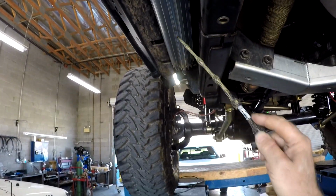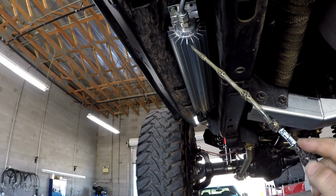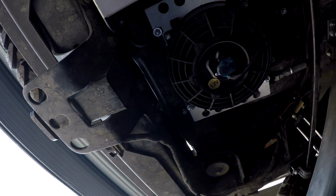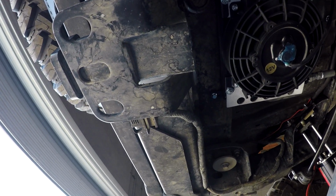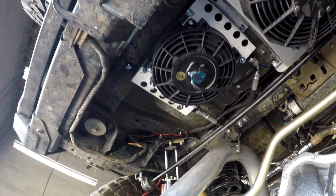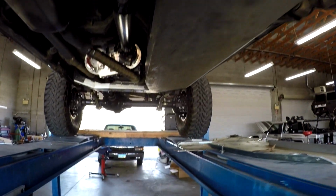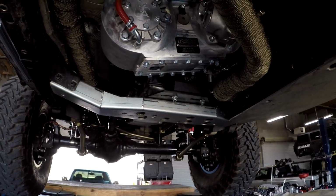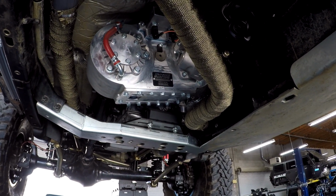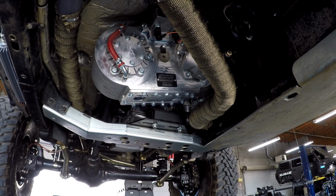And you can see over here we have the rail coolers. This happens to be for engine oil, and we've got the hydraulic line crimped, and it's coming back here to an additional cooler that is recessed up in the back where the muffler used to go. We got both the transmission and an engine oil, and when we combine all this together, this Jeep ran cool on a 110-degree day out crawling on the mountain at higher altitude. So it took a lot. That's 7 coolers to keep this Jeep cool.